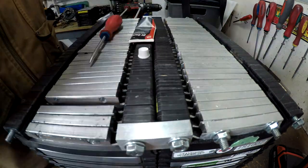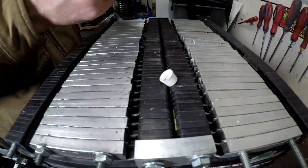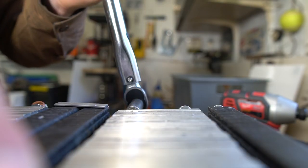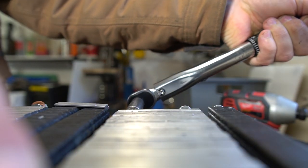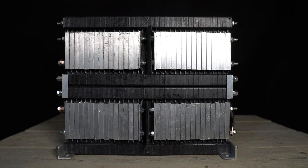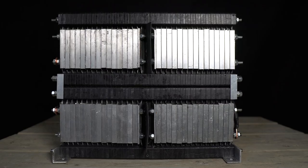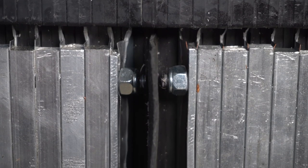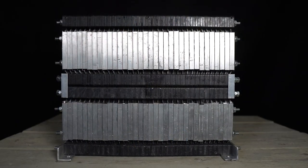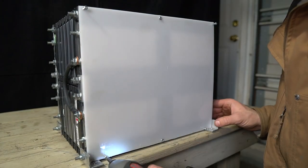This was tedious and took a long time, but I really wanted to do this correctly and not take any risks. I used an inch-pound torque wrench to ensure that all the connections were nice and tight and that there weren't any loose connections. Here's a better look at the finished batteries. I made up some thinner bus bars for the inside connections so that I had a fairly large air gap between the two cell groups. The two cell groups are separated with an empty battery case and a piece of rubber in the middle, and the other side connects the two cell groups solid all the way across. The last thing I did was cover up the bus bars with polyethylene sheets.